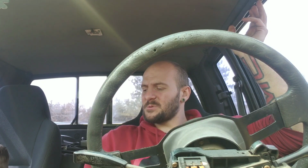He's going to send me the flanges, the T4 flange and an SRT manifold flange, and he wants me to tack weld bars on it for the exact turbo placement I want, which is really cool. In all fairness, stuff like that's expensive, but it's reasonably priced for both the custom intake manifolds and exhaust manifolds. It will be a T4 flange and externally gated.